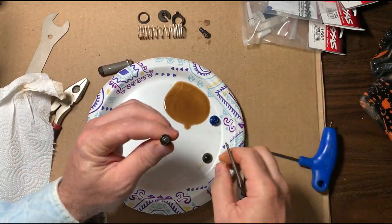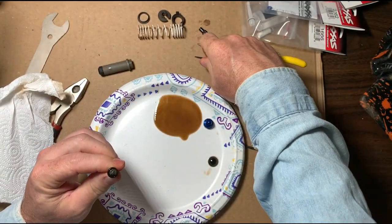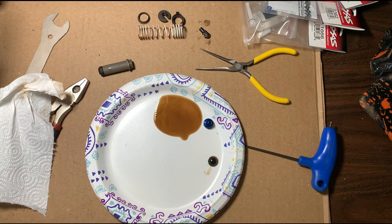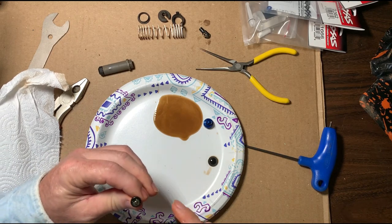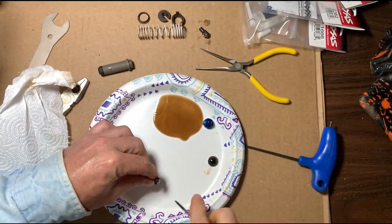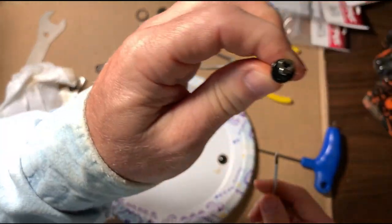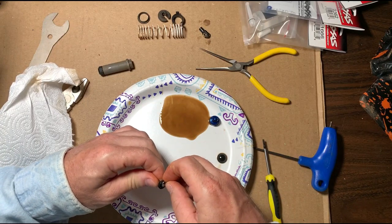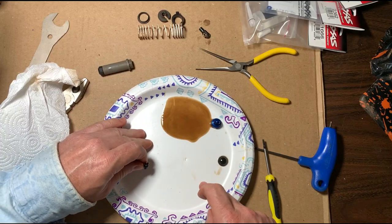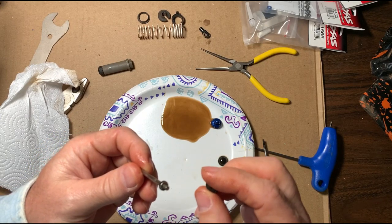Take the shaft, take the plunger off the shaft. You have to get a little screwdriver, stick it inside the little gap in the ring — the c-clip — just like that. Hold the shock, push it down. As you can see, it made it loose. Go ahead and pop it off and set it to the side.